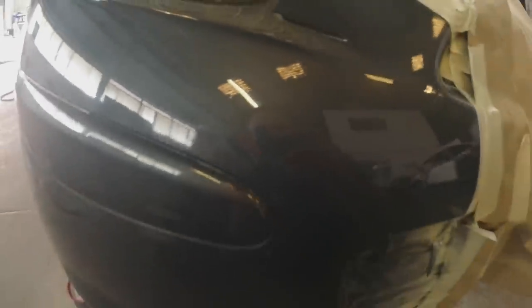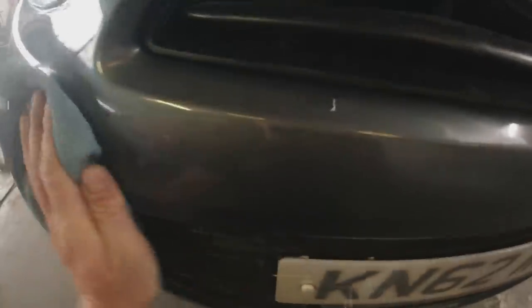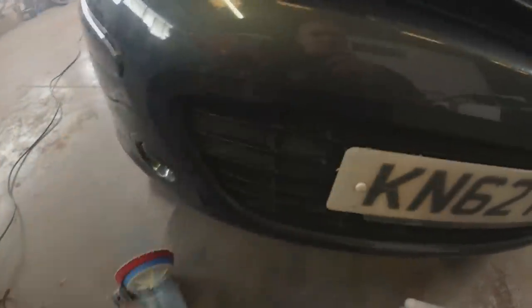Following morning on the Micra - it's flattened overnight. To be fair, I don't think I need to do a lot of polishing because it's got very low orange peel. Let's get a light on it for you - yeah, very low on the orange peel side of things. I just think I need to give it a quick buff off and we'll be good to go. There we go - now you spot the blend for me. Can you spot where the two colours went into each other? We've got a nice shine on it as well. There's the two blend areas - looking good, isn't it? I think the new paint is slightly darker, but the fact we've blended it in won't make it blindingly obvious. We've got one more blend area down here - I've just got to hit that, and then no more fiddling. We'll call it done.